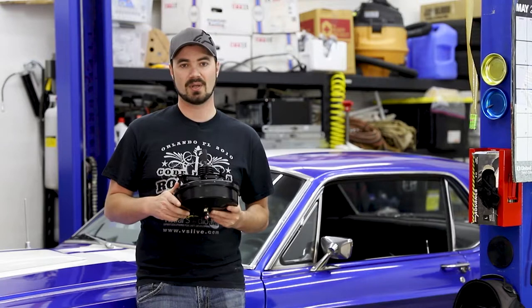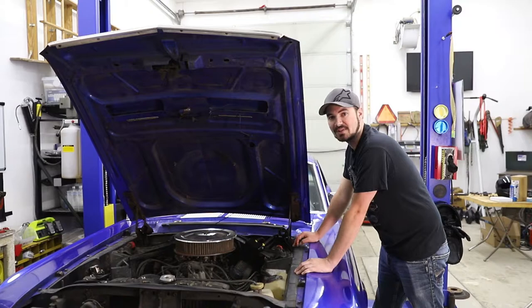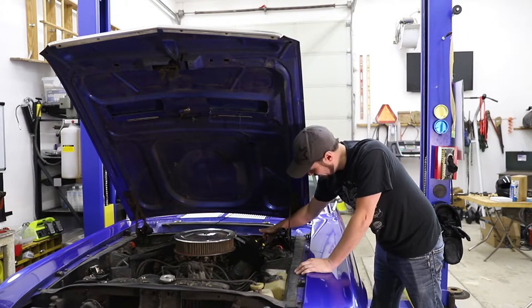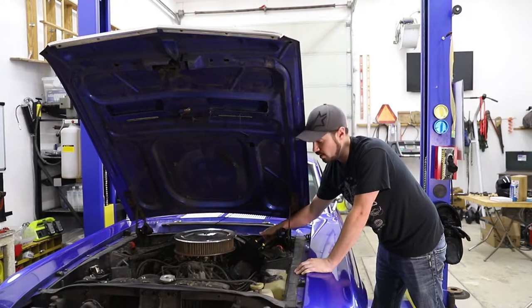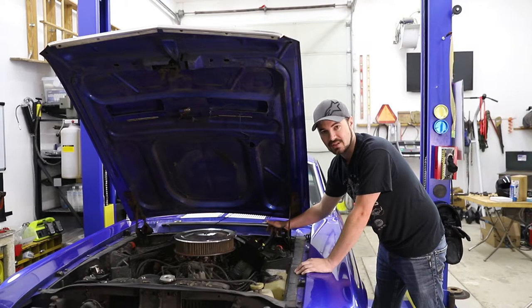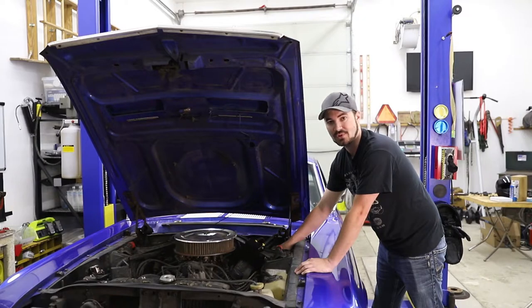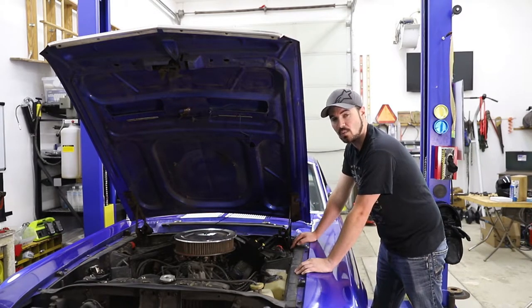So let's get under the hood and see what we're dealing with. The brake booster is located right here just ahead of the master cylinder on the firewall. There is a vacuum line run to the unit from the engine that I'll have to remove, as well as removing the master cylinder in order to get the brake booster out. I'm hoping to keep the fluid in the system and not have to disconnect the lines, but let's start by hunting down what tools we will need to detach this thing from the firewall.